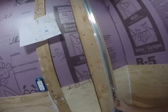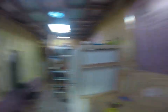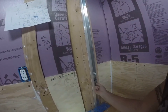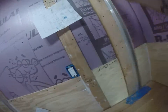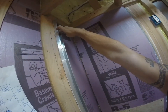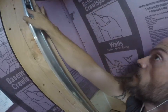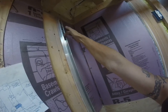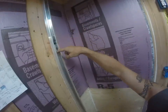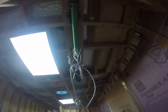Basically, these are the two catch points. They'll screw in here and there's a spring here so that the bed can pull out as the truck shakes. It goes up into the top position, at which point you run the pin through this. We'll have a stopper on the bottom for it to rest on. It'll be in the upright position — probably right here is the top position. You run the pin through right here at all four corners, and then it's load-bearing, because this is only rated for about 450 to 500 pounds.